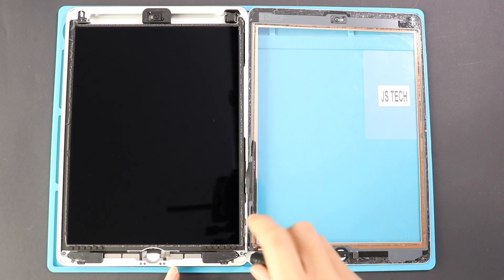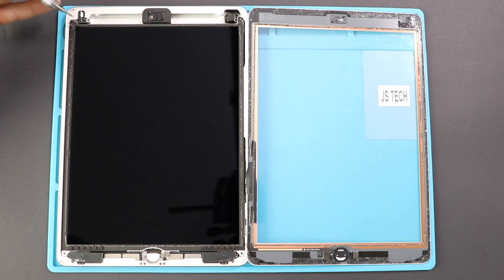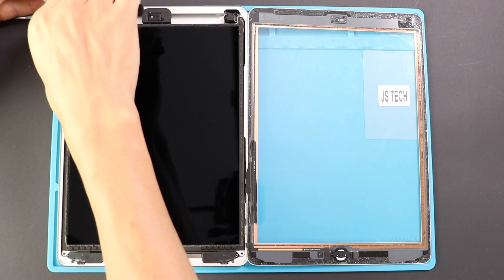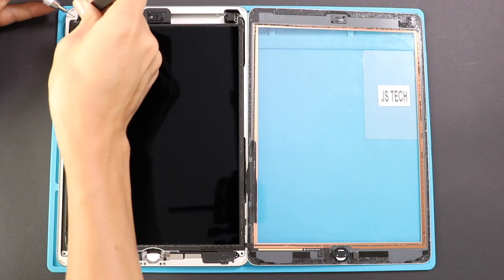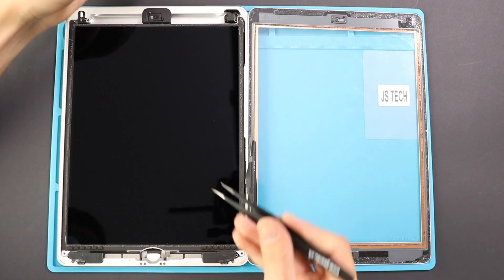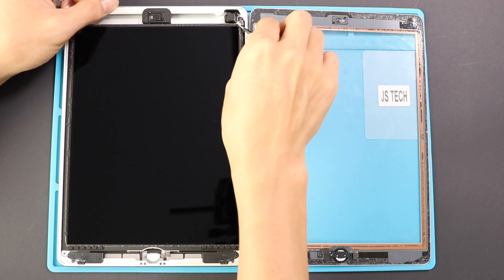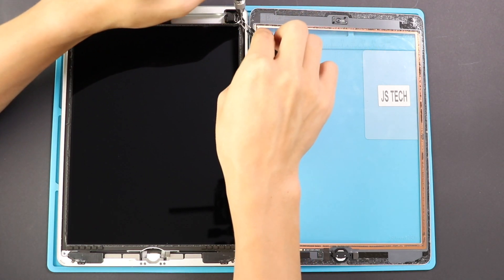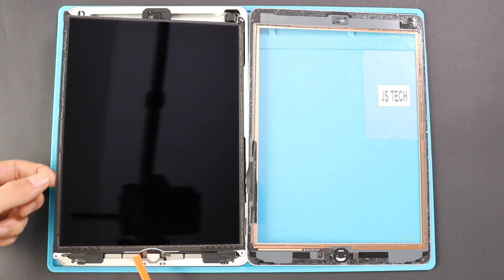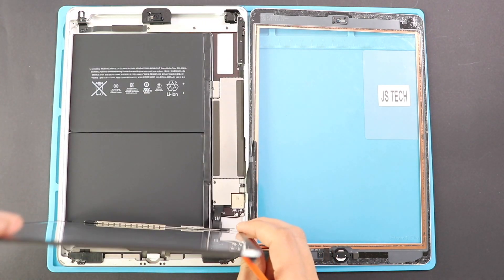Open and place it like an open book till removing the LCD screen. Next, we can take off the LCD screen by undoing screws. Remove four screws on all corners — sticky tapes are covering the screw heads, so peel them off and take them out. Then lift the screen to 90 degrees by the top and disconnect the plug by undoing three screws and the shield.